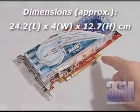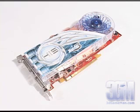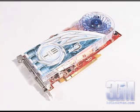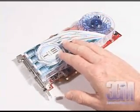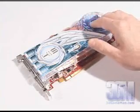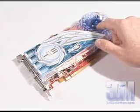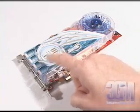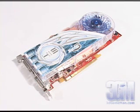This PCI Express video card is based on the ATI R520 chip, which is built on the 90 nanometer manufacturing process. The cooler on this card is quite large and comprised of a plastic top with a blower-style fan. This fan pulls in cool air, forces it across the heat sink, and then ports all the warm air outside the case. It's an excellent design that works very well and is used on most HIS products.